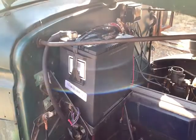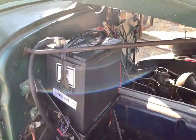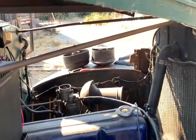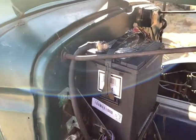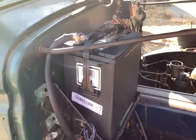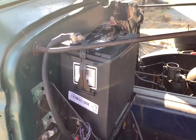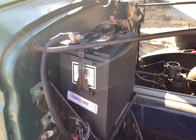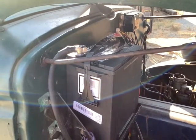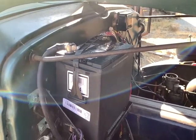The other thing I did was I took the other battery back and swapped it around, because as you can see the bar that goes from the firewall to the front, it was getting in the way if the battery was turned around the other way. So I swapped it around, replaced it with a standard post mount — negative on the right and positive on the left — so that we can clear the support.